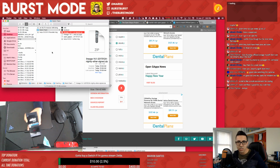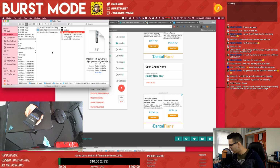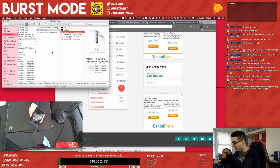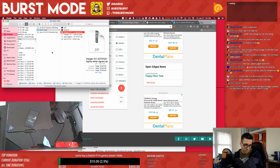This is kind of hard to do because it's upside down. I've got to figure out a better way to do this. But here in recovery mode, you've got power off, restart, recovery, and fast boot. Excuse me, this is fast boot. Recovery is what we're going to be flashing very shortly. Using the volume keys, you can cycle through those, and then the power button is going to say yes or no. So we could power it off right now, just put it back to exactly where it was. You could restart the device, pop it into recovery, or put it into fast boot. We're going to put it into fast boot mode because that's what we need. That's where it is anyway. That's what it boots into.